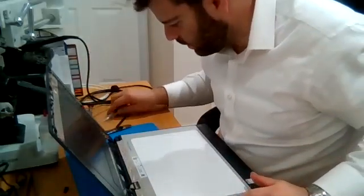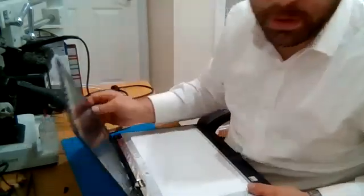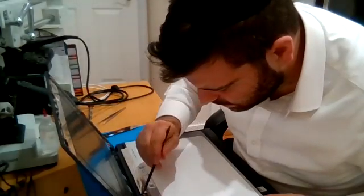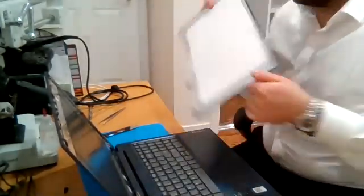Okay, we'll flip the screen down and we're going to pop this — there's a little clip here, you can see that clip. Open it, remove the cable, and take the old LCD out — that's garbage.